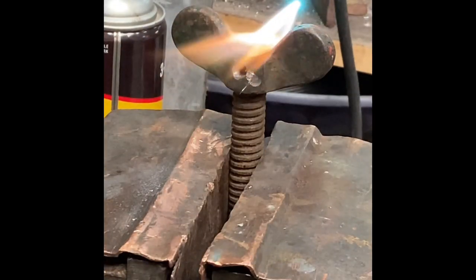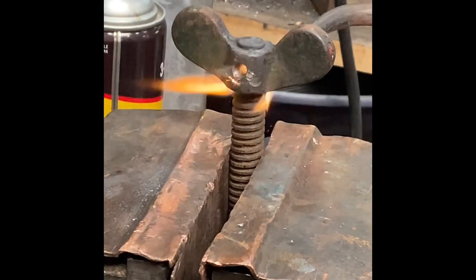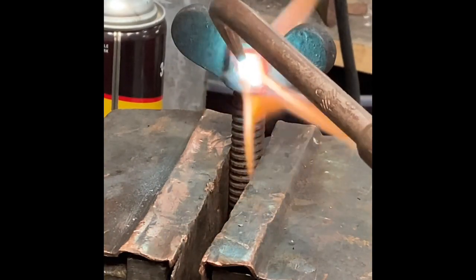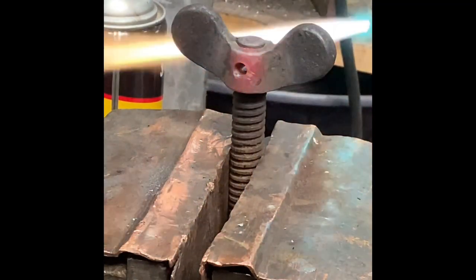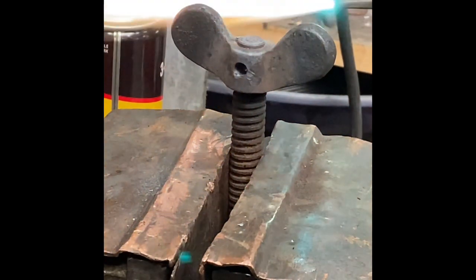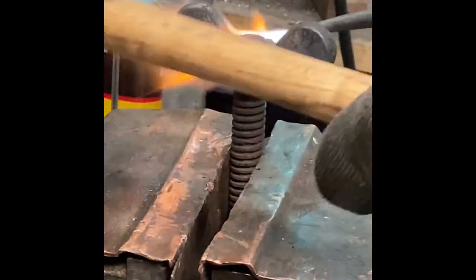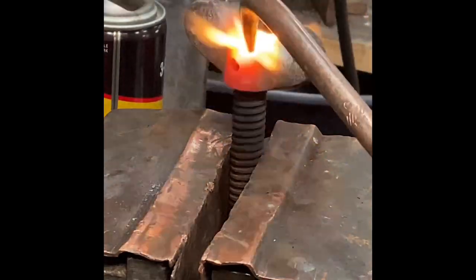So I found even with that pin removed, that wingnut wouldn't budge and I didn't want to risk breaking it. So it's time to get heat — heat is your friend in this situation. That allowed me to get it red hot and try to break the bond. And this is about the only time you use oxyacetylene these days — it allows you to get very high, very precise heat. And just gently tap, tap, tap.